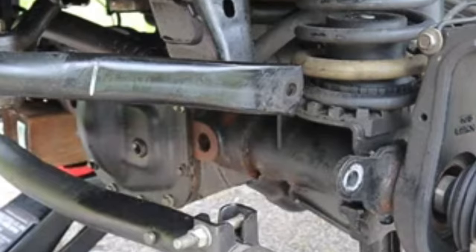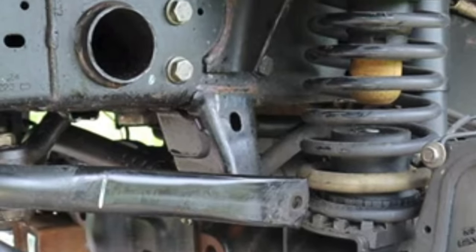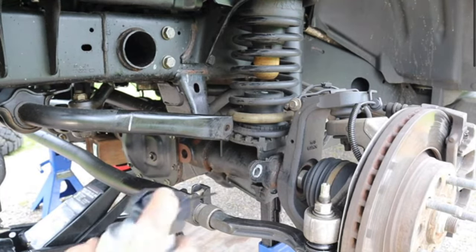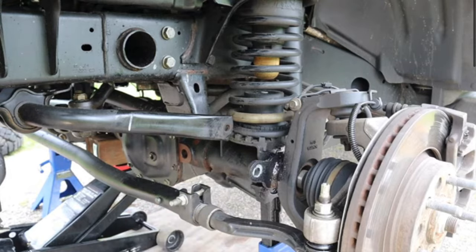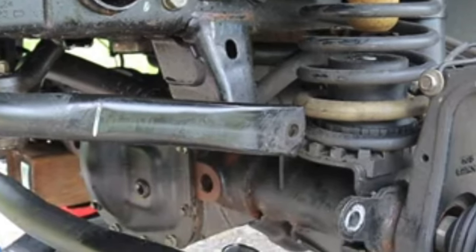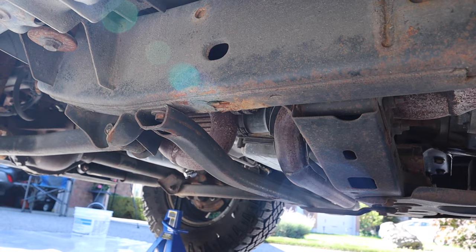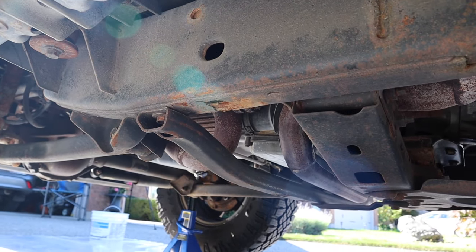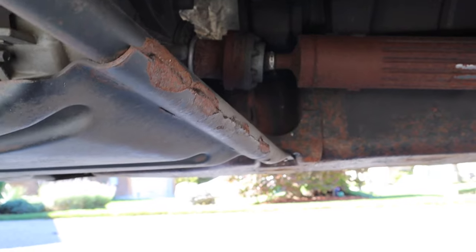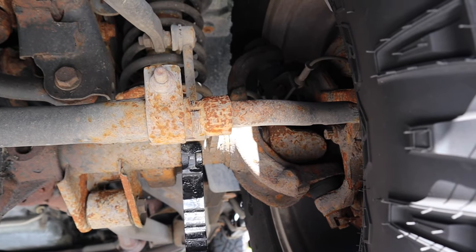You can see here at the leading edge of the axle and at some frame-weld locations, rust is showing through even though I have had this frame rust-proofed. I have been spot-spraying some of these areas, but now that I know with the off-roading I do and the miles I put on that the product comes off easily, and the reapplication of coats costs about $90 plus tax Canadian, I'm going to investigate doing this myself. And here we have the frame of my wife's 2012 JK, and it looks like it could use a little attention as well. Given that I'm going to be doing the rust-proofing myself, I'm going to be paying close attention to the leading edges of things like the skid plates and the front track bar.